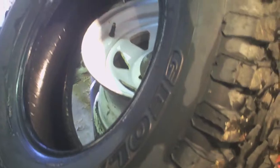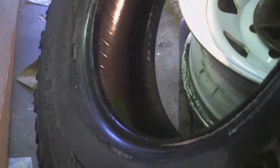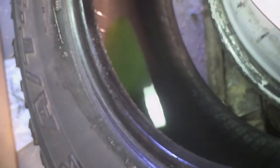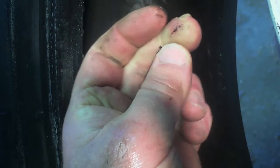It's true that this is only an eight month test, but it's still an eight month test. I figured the biggest telling factor — if the antifreeze was going to eat the rubber — would be if the antifreeze was no longer green. But as you can see, it's just as green as can be down inside there. The rubber does not feel softer, though when I scratch my finger across it I can come up with some black.